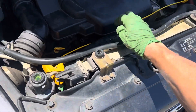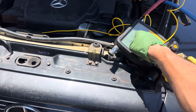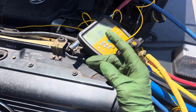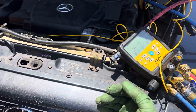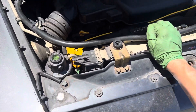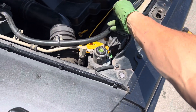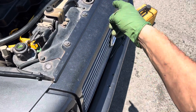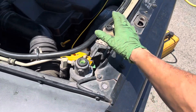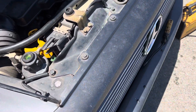This allows the pressure to go all the way up to 220 or 240 psi before the fan kicks on — it's called thermal runaway. In really hot conditions it can never recover. But if the fluid fan clutch is working really well, up to a certain temperature it takes over, and in some conditions on some vehicles you will never hear the high-pressure fans even kick on because the thermal fluid clutch is doing such a good job. Since this one is not, it's totally relying on the electric fans — and this mechanical fan is free-spinning under these conditions.